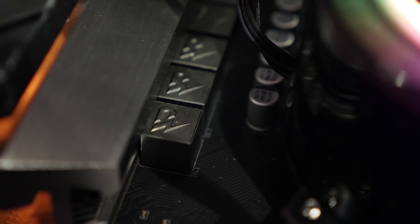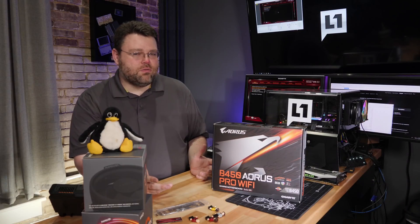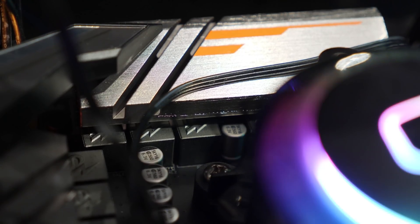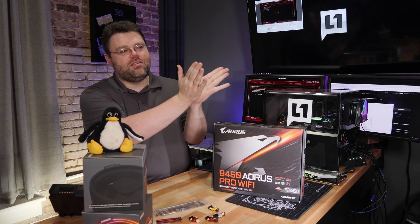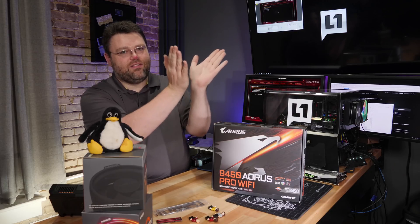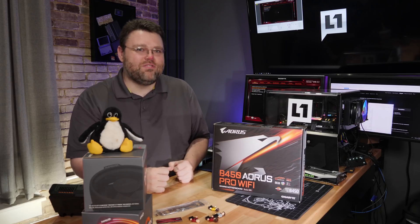It's really a four-phase instead of an eight-phase on one side, and the graphics/SOC side is a three-phase. So it's really three plus four, which is similar to some other motherboards, but they did double up on components. When you look at the layout around the VRM, it looks really beefy, but it doesn't actually have separate phases. It can still deliver a lot of power to the CPU, but all the extra VRM circuitry — because they're not truly isolated phases — means the strong men aren't pulling in parallel, producing excess heat or friction between elements.